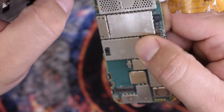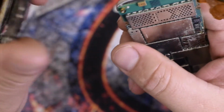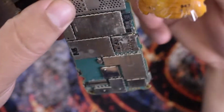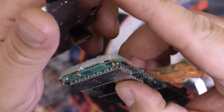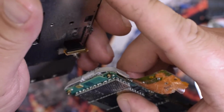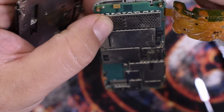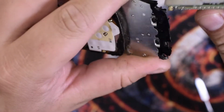These screw nuts are molded here in this plastic part, and for some reason they were either very tightened, or, if I'm looking at one of these screws, it has, I don't know if I'm saying it correctly, locking or blocking paste on it, and it got blocked on the thread. And when I turned the screwdriver, it actually turned the nut in here. It got unstuck from the plastic, and it was literally just rotating there in the plastic. It would never be disassembled unless I forced my way. I ripped here and here and got like this.